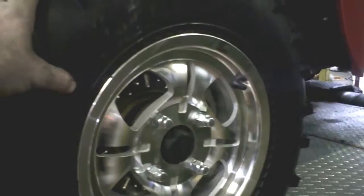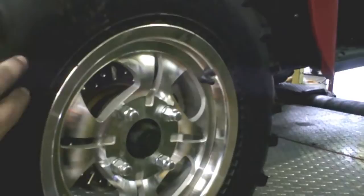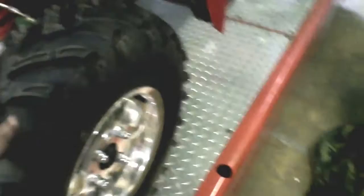The next step was putting on the front and rear wheels and tires. These already come installed — all you gotta do is fill them up with air. We put in around 7 PSI; some people run 5, you can run up to 10 — it all depends on the terrain and the situation. On this particular model, 7 PSI just works perfect. One important note: always remember front wheels and tires are thinner, the rears are wider. Some people have actually mixed those up and the front ones end up rubbing on the suspension — so remember: front thin, rear wide.